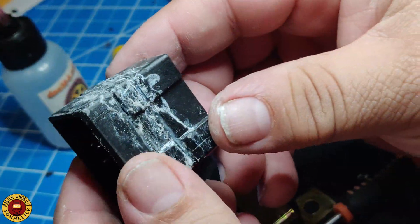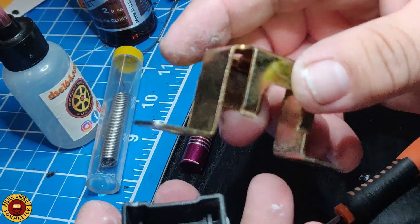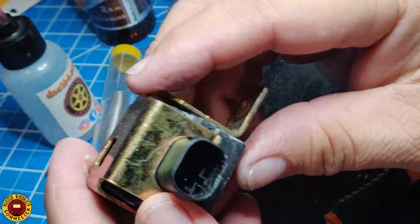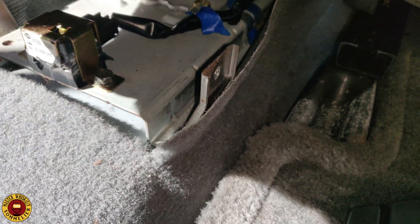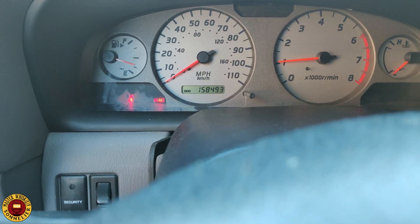Once you're sure it's working, I used gorilla gel glue with some accelerator to put it back together. It's not pretty, but nobody's going to see it — the important thing is that it works. Here is the metal frame; if you did a good job it will slide back into place. I used electrical tape on the underside to cover it up and keep dust out. The sensor is back in its original location, secured with the 10mm screws. Here is the startup — ABS light went off. Thank you for watching, hope this helps, I'll see you on the next one.